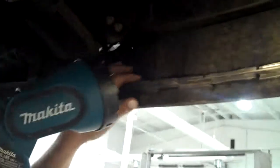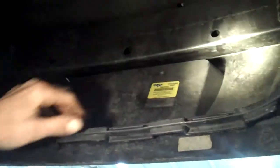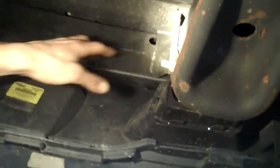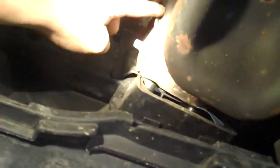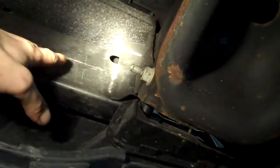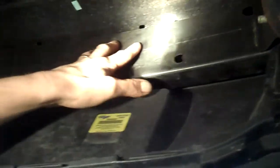So from Jeremy and I going over this, we got it up on a hoist and looked at it. It looks like the fascia has been replaced — that's a replacement part sticker — but it's a good part. Looking at the welds on the frame rails and the bumper reinforcement bracket, that's all welded on. It doesn't look like any of them have ever been taken off and re-welded. Feeling the back side of this, there's no damage to the bumper reinforcement.